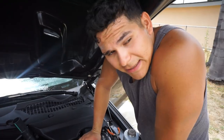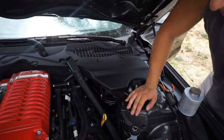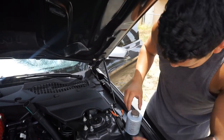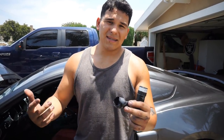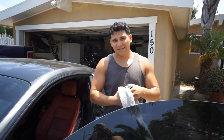Another pro tip guys — follow the instructions. Per the instructions, I'm supposed to do this side first, and it totally makes sense now because look at the situation I'm in: this side's in but look how much slack I have to work with. Per instructions, the easier way to get the tube through the firewall is to wrap electrical tape around it and give yourself a nipple to pull on. I didn't think it would work so I skipped it. But I barely grabbed it, my buddy Georgie pushed on the other side, and it went right through. Sean, you're a genius — follow the instructions.